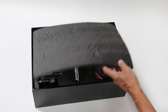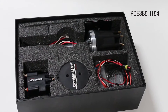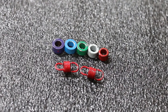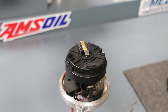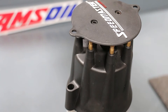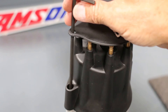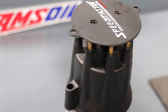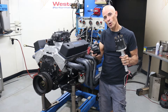Now that we've opened the box, let's take a closer look at what's inside. Included in the Speedmaster ignition system combo kit was a built distributor and high output coil, along with the wiring harness and all the hardware necessary for the installation. Also included was a variety of springs and bushings to allow you to dial in the advance curve to your combination. Removing the cap and rotor provides access to the springs, weights, and bushings. The bushings determine how much advance, and the springs tell you when that will happen. We like the fact that Speedmaster provided provisions in the plug wire retaining cap to facilitate distributor cap removal, and that the kit included an allen wrench that fit all the mounting hardware including the cap, rotor, coil mounts, and terminals. We've set our springs and bushings — now it's time to slide this baby in, hook up the coil, and fire it up.